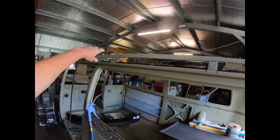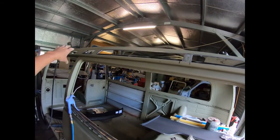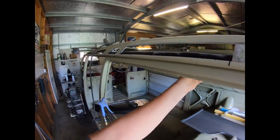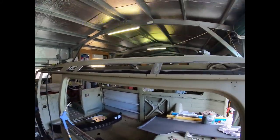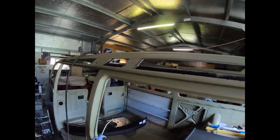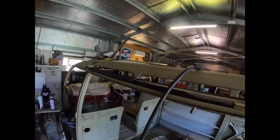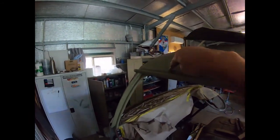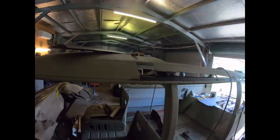Even once you weld that in and then paint the car, we add more rust treater again from the inside, like from here we blow it down and it all runs down into there, and it should prevent all that. And in these areas, that's what you got to do. You just got to get the rust treater everywhere. See, along here there's no holes at all, so we should only have to rust treat that from the inside right through. So that's sort of what it takes.